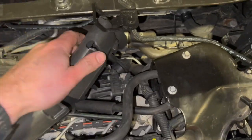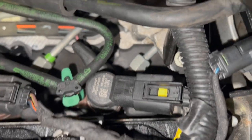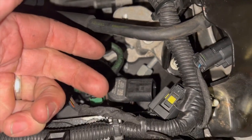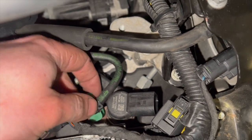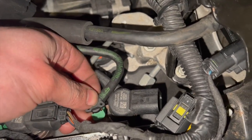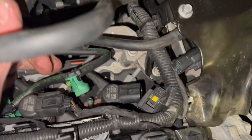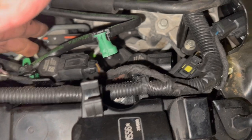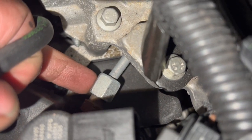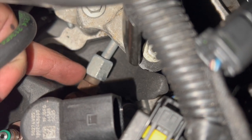First, give yourself a bit of room — tuck that foam out of the way and move the fuel pipe a little bit. These three injectors aren't too bad to access. The connector's already off so I'll pull that out and tuck it away. For the return pipes, you need to cup your fingers under both green tabs and press down in the middle as you pull up — that'll pop the return hose off. Because it's the end one, you can just pull it off and push it out of the way. If it's a middle one you'd need to undo a few to get it out. Then we've got a 14mm on the high pressure hose — undo that completely and just slacken off the other end.